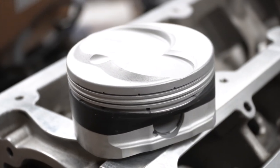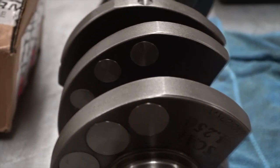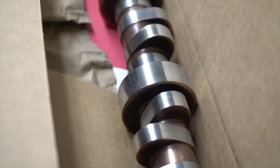One of the best things about going back to this setup is our ability to get rid of the heat exchanger in the back of the car — engine water to engine oil — as well as getting rid of the entire engine oil cooler. The engine builder on the Nexus motor recommended only about 65 to 70 hours on that engine, but that car had been run hard up to about 110 hours. When they pulled it, the motor builder was absolutely shocked at its condition. It only needed rod bearings, crank bearings, cam bearings, and new pistons — and it's cranking again.